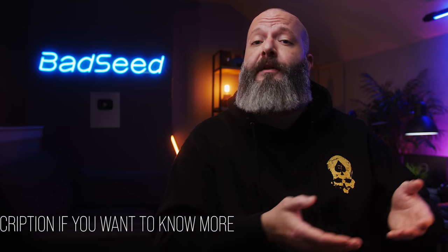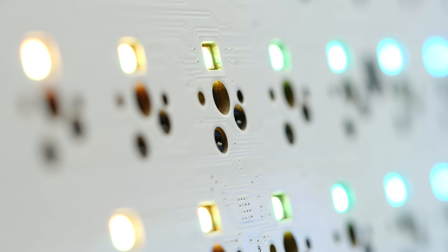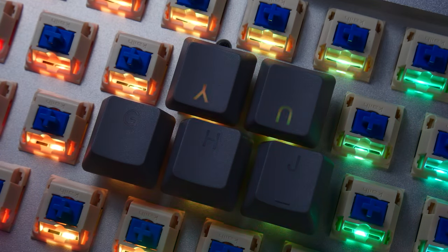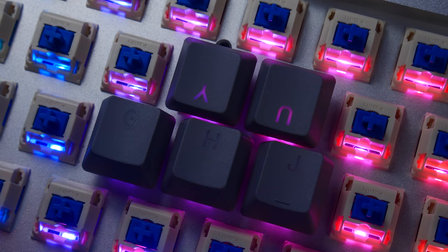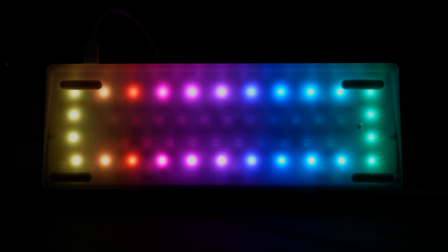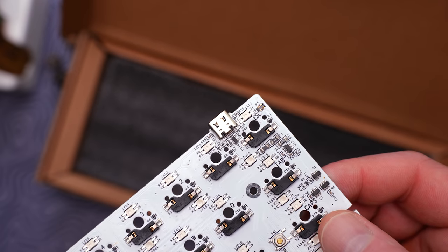That may garner some criticism from keyboard purists out there who are looking to avoid any potential interference between certain combinations of switches and cherry profile caps. But so much of Drop's keyboard aesthetic is based around RGB shine-through caps, and the vast majority of those have a tendency to function better with north-facing LEDs than south. You also have a pretty good amount of down-firing LEDs on the underside to support underglow, and you'll see they've retained their habit of offering both left and right side mount USB-C.